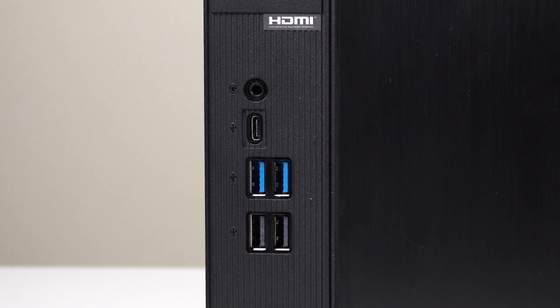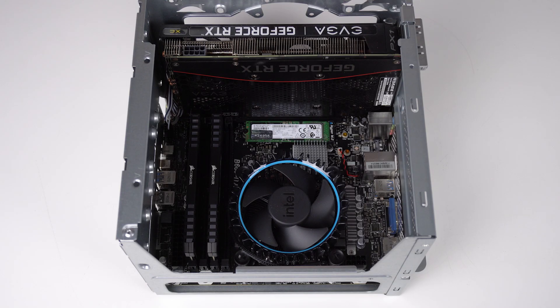I think the DeskMeet is a really cool DIY mini PC. I love the form factor - when I pulled it out of the box, I was even thinking about building one for myself. But there are limitations: first is the lack of small form factor coolers for Intel's LGA 1700 platform, and you've also got the power limit of the included motherboard, so expect mostly base 65-watt performance. The IO is great and there are plenty of storage options. I like the modest black steel exterior and of course the small size. Being able to fit a dual-fan card was a big win. I'm also curious about a design where you'd put the power supply and storage drives under the motherboard, then you could expand cooling options on top.